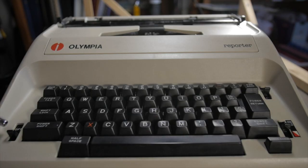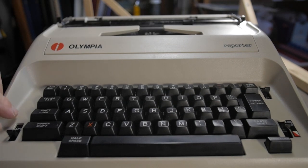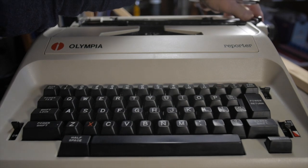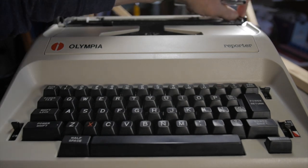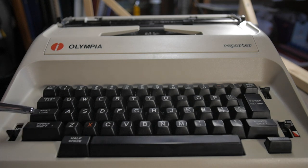There's a power switch on the left side of the keyboard that also has a mechanical interlock to the carriage lock itself, so in the off position the carriage will not move. In the on position, even unplugged, the carriage is permitted to move with the carriage release lever. It has power shift and shift lock - the motorized spindle underneath the keyboard does the shifting. It's a segment shift with power tab, so it has tabs and a nice tab braking system so the carriage doesn't go flying.